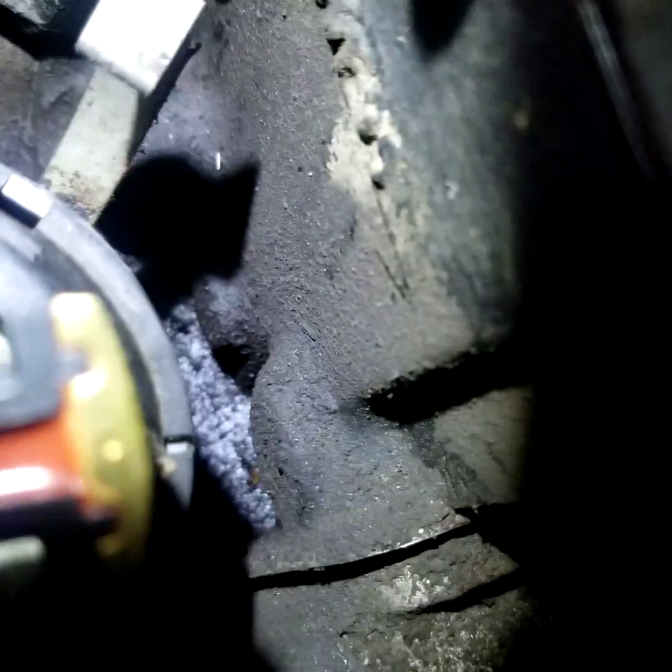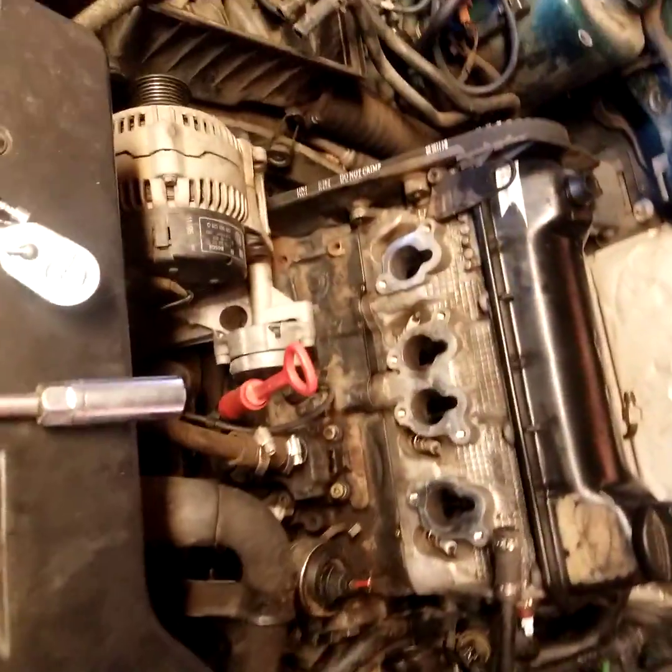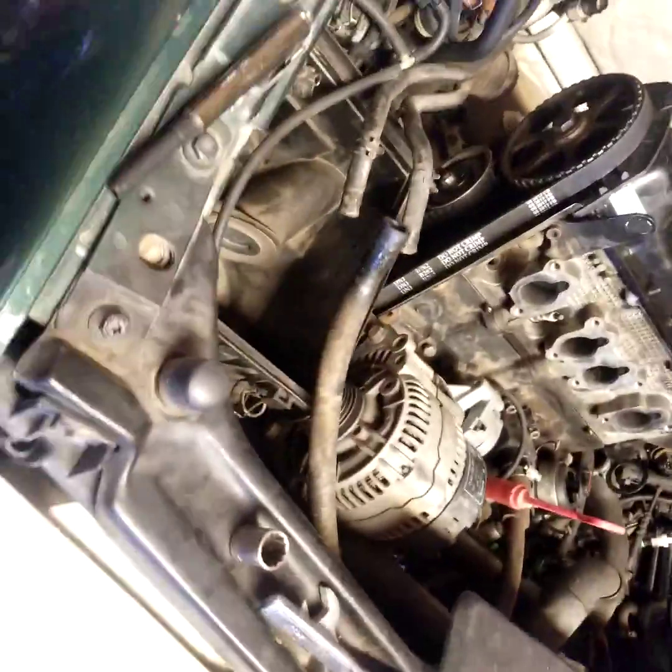See right there — there's that mark. That's the top of the cap. On the end of the distributor housing itself there's a mark down there. You've got to have that lined up for your oil pump to hit and the shaft to sync up with your cam and everything else.